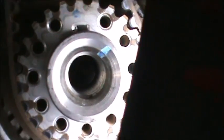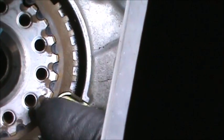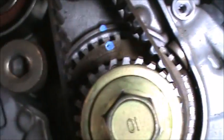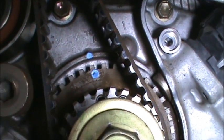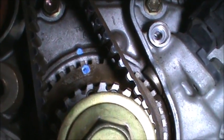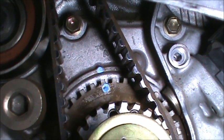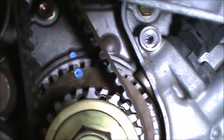So this is not a broken belt or anything, so we know as long as it's lined up from the top, it's good, lined up from the bottom over here. And then I'll show you exactly where the mark is. It might be this right here. Might be that. Let's find out. So right there in blue, I marked it blue. There's a little indentation in that back plate, and then there's also right there below that T, there's a little knob. So those are perfectly aligned.